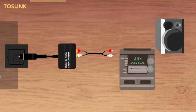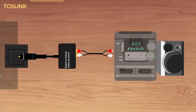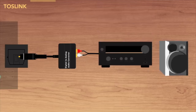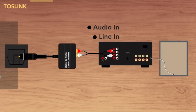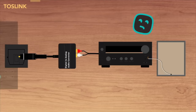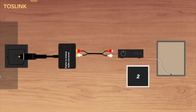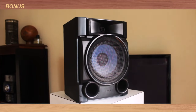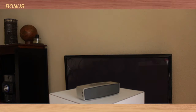Now if you have a stereo receiver but it doesn't have any ports other than speaker wire, you can still use your speakers on any other stereo receiver within the same ohm range that does have RCA inputs. Don't forget to change your receiver channel to the one you plugged your converter into. If you don't want a big stereo, you can cut down to just a mini power amp, which will take the cable from your TV as well as your speaker wires. As a bonus, you can also use this with an AUX music player to enjoy those loudspeakers you already have.